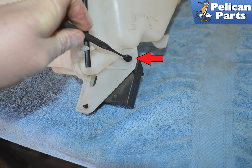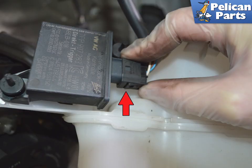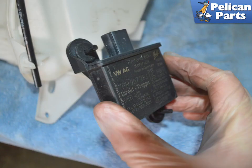If the pins cannot be pulled out with pliers and you need to remove the reservoir, use a metal punch to press the pins out through the back of the removed reservoir. Once the pins are pulled or pushed through, use a flat head screwdriver to pop the rest of the pin out of the hole. To disconnect the electrical connector, press in the release tabs, then remove the antenna from its mount.